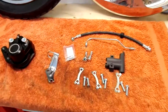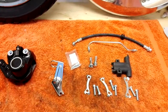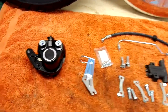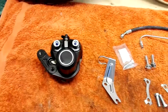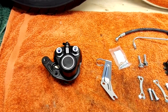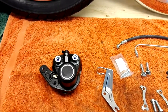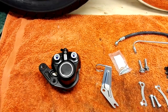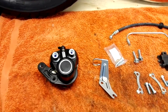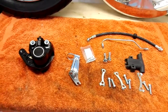Here are basically most of the parts for a twin disc conversion apart from one particularly important part. An item to note is that that's a right hand caliper. I say that because they are available for Z1s but they are not currently available for KZ900s and Z900s. The calipers are different and I don't think they'll fit, and a left hand caliper will not go on the right hand side of the brakes. So at the moment, March 2017, you cannot get a new caliper for a Z900. But for a Z1A, Z1B, or Z1 they are available.